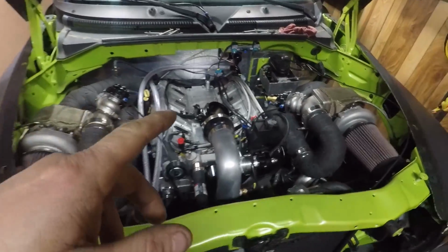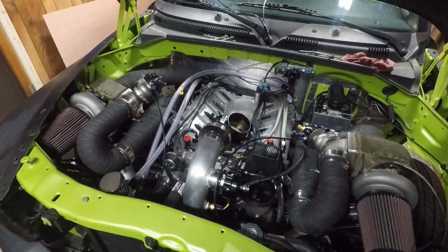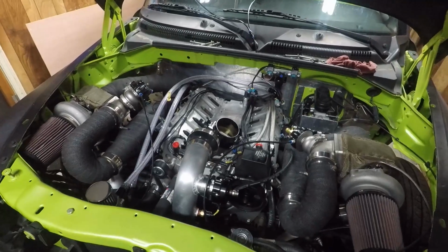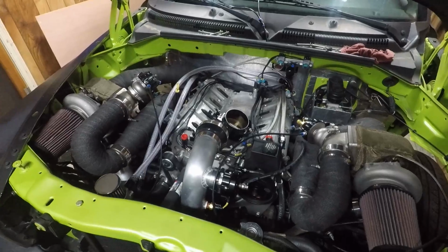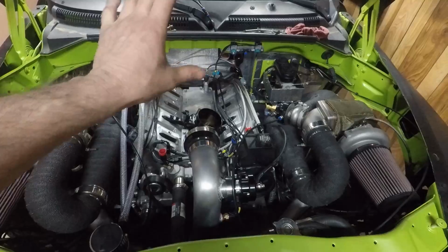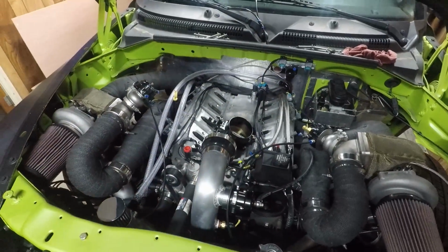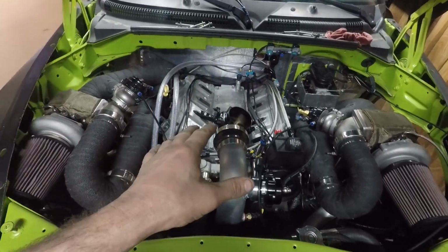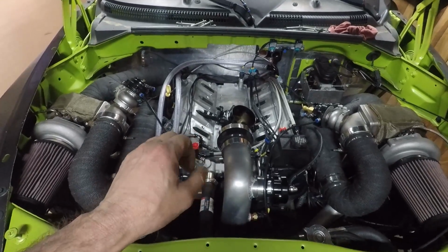Yeah. So that's where I'm at. Before I tore it apart that Saturday, I was pretty pissed off. And there's my phone blowing up. But I was pretty pissed off, so I wanted to hear this thing run. So like an idiot, because by this point there's gasoline just pooled on top of the valley cover. It's run down the bell housing, and it's all over the shop floor. Because with that 4303 pump back there, it moves a massive amount of fuel, way more than a stock pump. So it didn't take long.